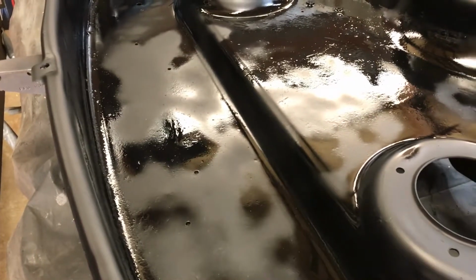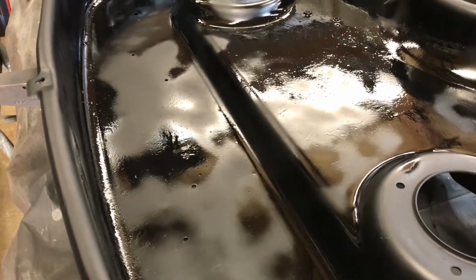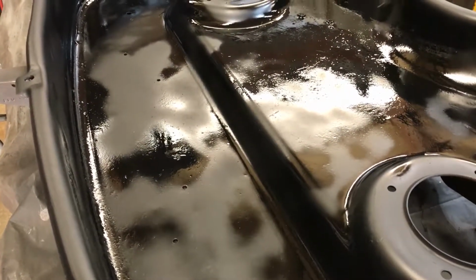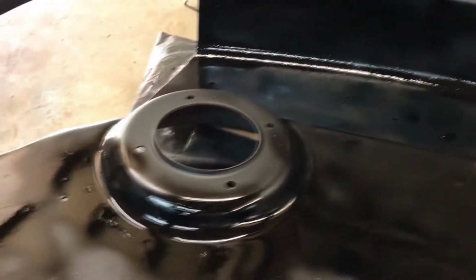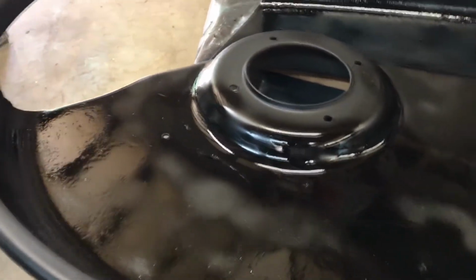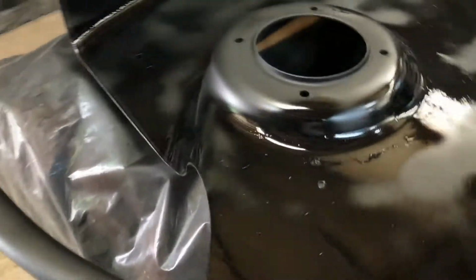Normally, if you've got a little layer of rust in there and you use conventional paint, the rust just seems to continue underneath the paint, and then the paint peels off. I'm not sure what this converts the rust to. I should look whether it converts it to black rust, since there are two different forms of iron oxide. The red kind of rust is what we normally think of, and then there's the black kind of rust on iron, which we often call scale.